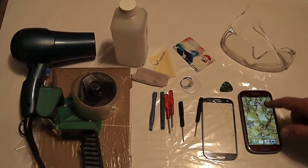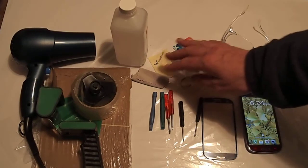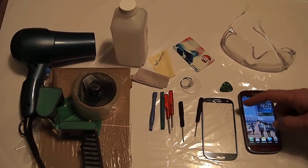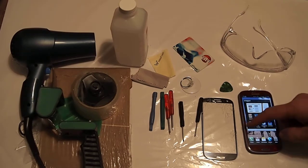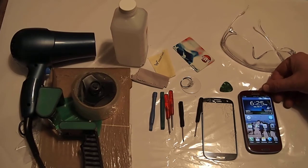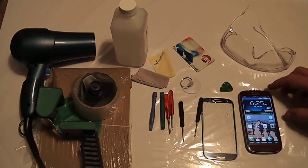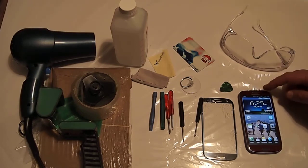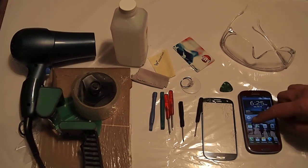Once I had that all cleaned off, I used rubbing alcohol and a couple of microfiber cloths to remove any markings. I did notice though that I seem to have some fingerprints on the underside right here — so everybody will know this is my phone from the fingerprints on the inside of the glass. Now it is working happily, and there are a couple of buttons right here attached to the glass of the screen, and those are both working properly. When I went to put it back on, I noticed there was a little something right here, so before really attaching it down by heating up the adhesive again and pushing on it, I lifted it up a little and cleared it — there was a little string of adhesive across the camera lens, and I thought that might not be so fun if that was left there.